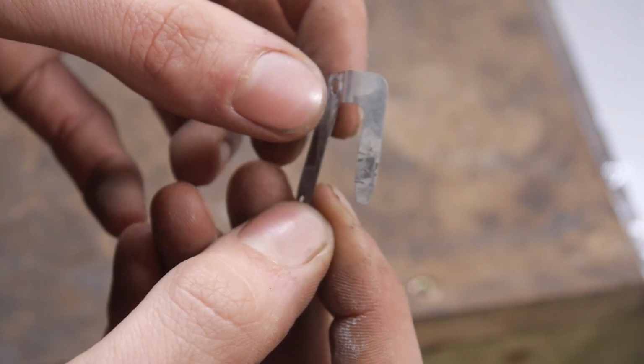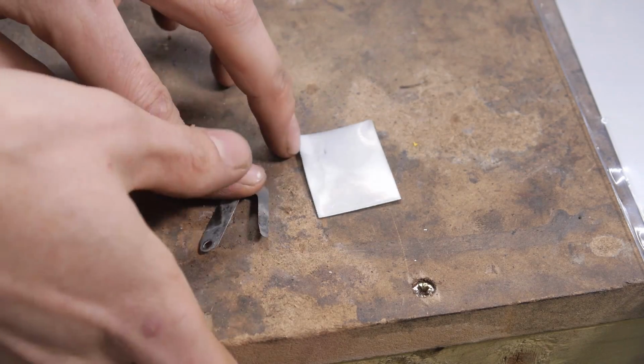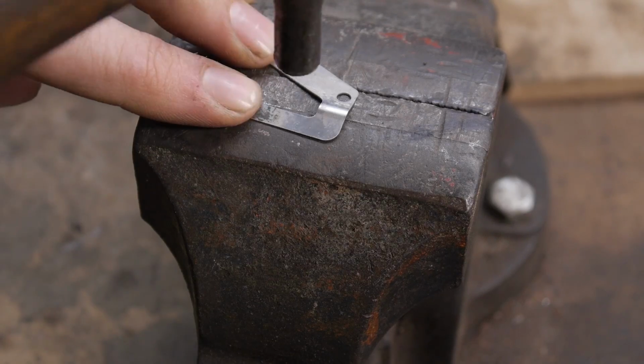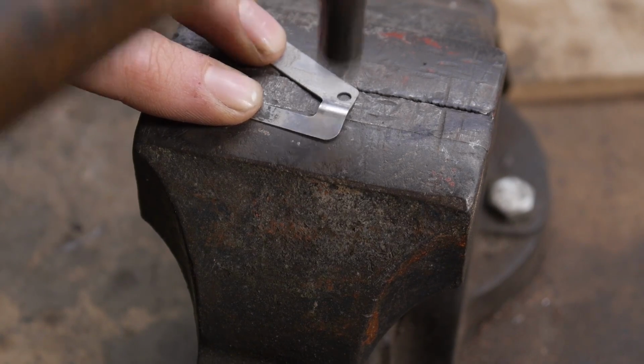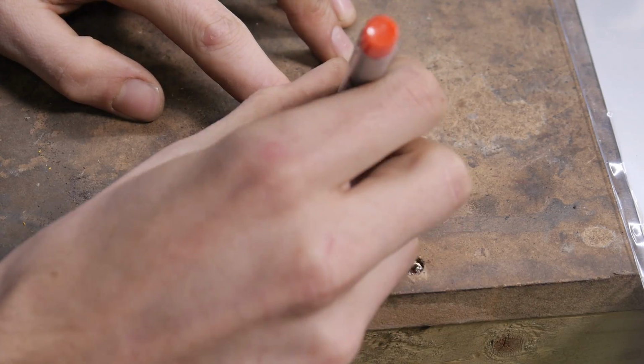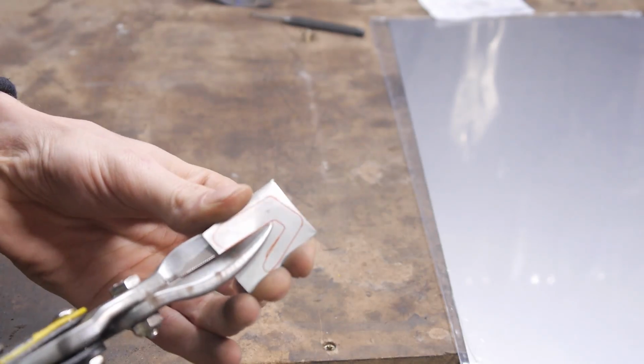When the key turns, a piece on the lock contacts this piece of metal, which then forces it into a solenoid switch, which then activates the central locking motors for all of the doors. Because the boot and passenger door locks had this piece attached, when the key is turned in either of those locks, the driver door would still lock even without it being present. The signal is still sent to the driver's door to activate the central locking motor.